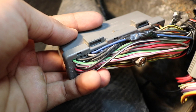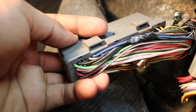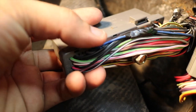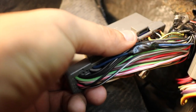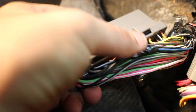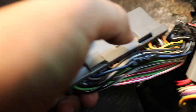And I actually put a picture of the pin in the link in the description, or I could just add it right here. As you can see, pin 21 is going to be the crank position sensor, and it's pin number 21, so right here. So now I'm going to take off the tape and splice the yellow into the solder. I'm just going to add a little bit of solder so it'll be together like a T, if that makes sense. So let me take this off.